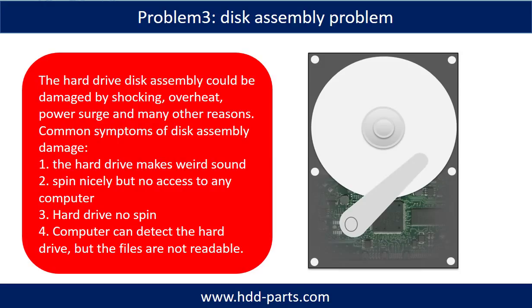Tips: if the storage is configured as mirrored hard drives, you can take the bad hard drive out, put in another hard drive of the same size or larger, and the storage will mirror the data to the new hard drive automatically. If this trick doesn't work, that means the two mirrored hard drives are both damaged, or the storage was configured as RAID 0, meaning the two hard drives work differently.